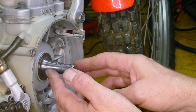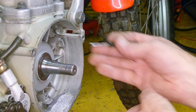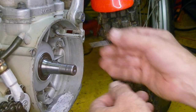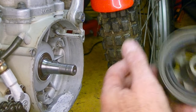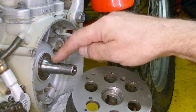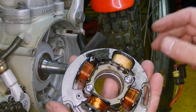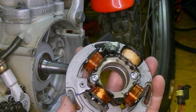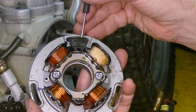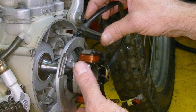I'm about to put everything back on here. I'm putting the stator plate back on but first I've just rotated the crank — you can possibly see there's a little woodruff key here which I've just reinserted into the slot. That's to locate the flywheel when it's on. You can probably see there's a little notch that the woodruff goes into, so you need to make sure that woodruff key is in there before you put the stator plate on. I marked the stator plate before I took it off, so hopefully I can get it all lined up with the timing right again.